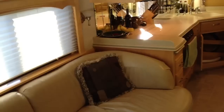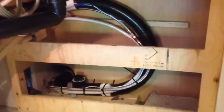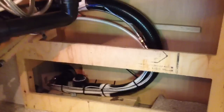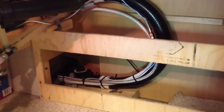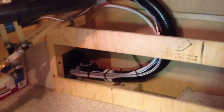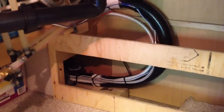I'm going to run the slide in and then back out just to give you an idea how Newmar connects the kitchen slide out to the RV. The access panel is off right now so we can see the plumbing exposed. As the slide begins to move in, you're going to see how that black hose and the hoses that are zip tied to it move with the slide out coming in, with part of the plumbing staying with the slide itself.